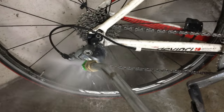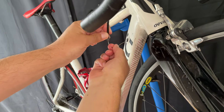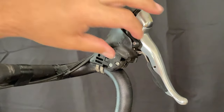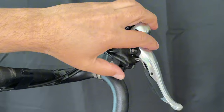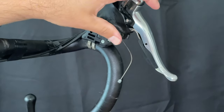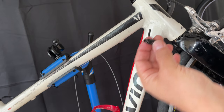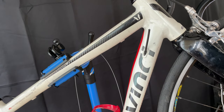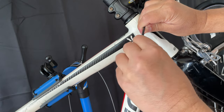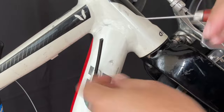The rear derailleur is cleaning up really nicely. I cut that little frayed piece off the front derailleur cable. You can see here how it works — the cables are internal. Underneath the 5700 series STI there's a little hole where the cable goes in. You find it by pushing the cable out and really paying attention to where it goes. Since this frame doesn't have any barrel adjusters I'm going to add an inline adjuster. I just make sure the holes in the cable housing are clear so the cable slides nicely.